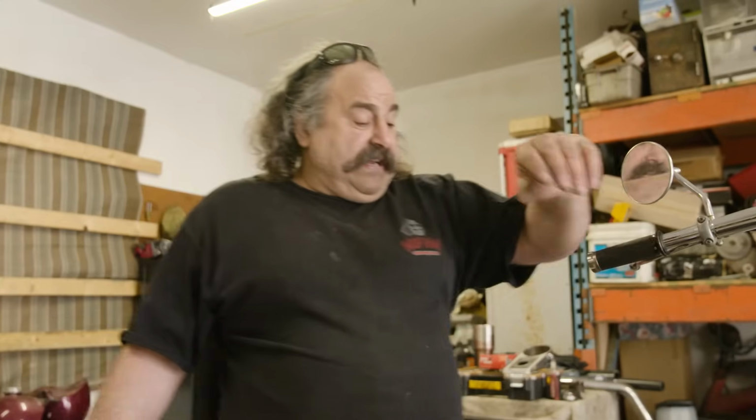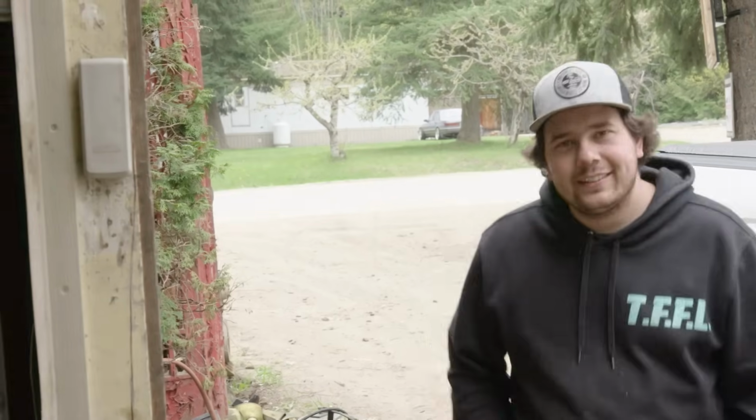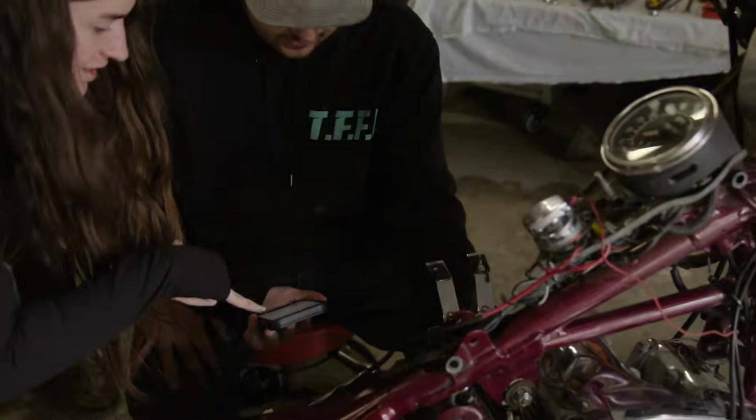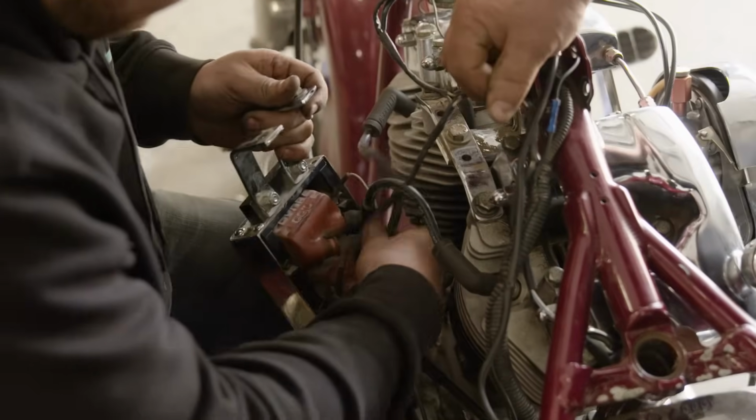When this cylinder comes to top dead center, it fires. But it fires this set of plugs and this set of plugs at the same time. This being a dead cylinder, it fires and just shoots a spark into nowhere land in this cylinder, on whatever stroke it's on. So the problem being is I don't know how to hook the spark plug wires up. Has he not Googled it yet? That makes sense. Rear cylinder, front cylinder. They're angled, so you can look at the angle on these. Here's the problem right here, I think. He's going to lay on the inside of this.